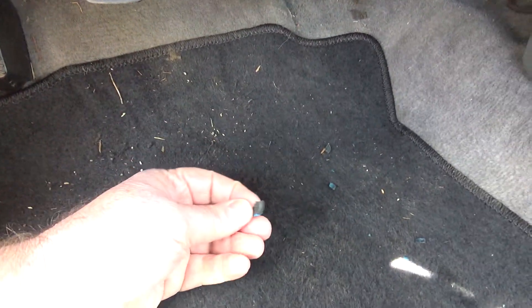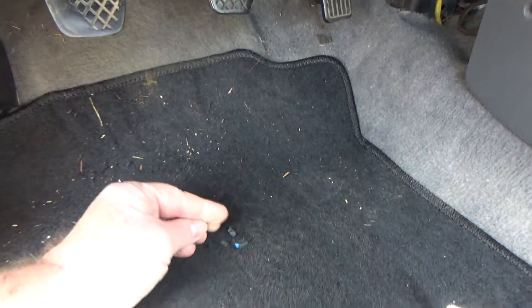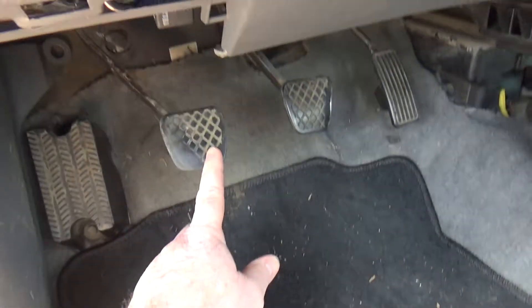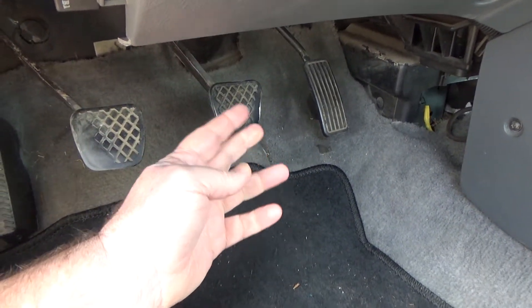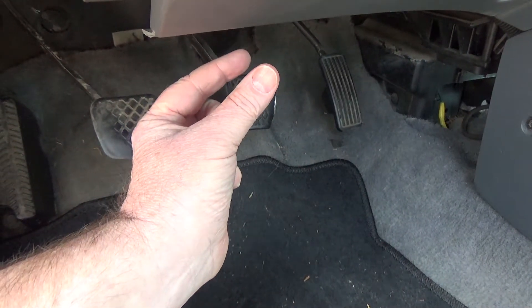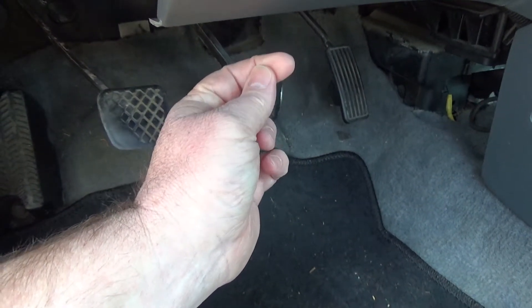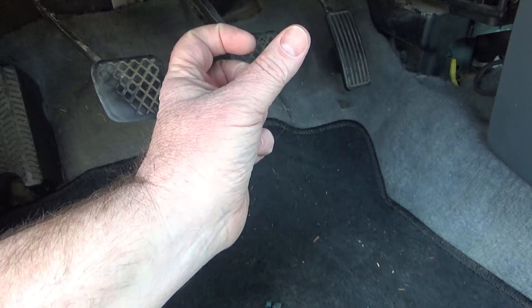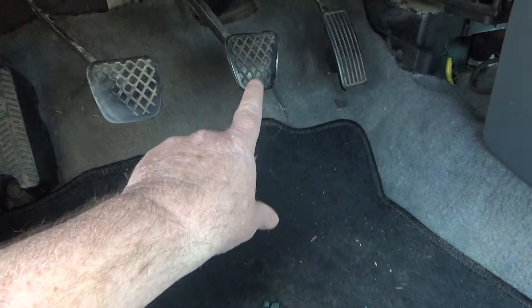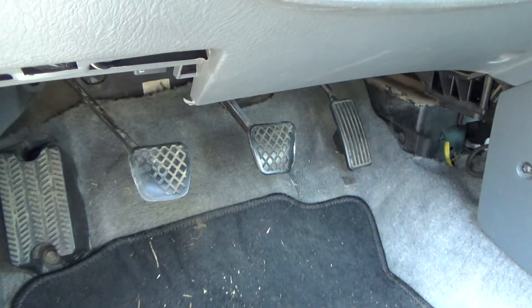Come into your car and if you look real carefully, you'll probably see little plastic pieces. Gather them up. What happens is there's a little plastic stopper under your brake pedal — right up in there — and there's a switch up there. When your brake pedal is not depressed, it presses that switch. That little thing went into the little hole, and so when it fell out, the switch can't be pressed by the pedal, so it thinks you're pressing the pedal even though you're not. That's why your brake lights are on.